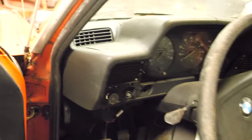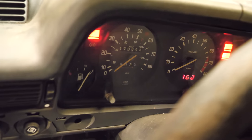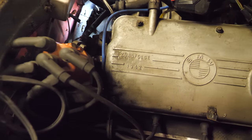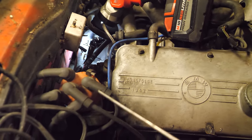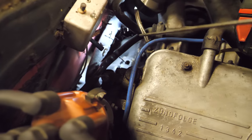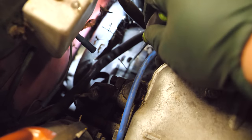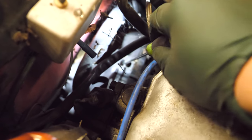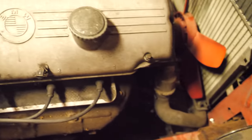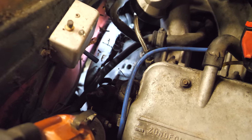Let's see if we have dash lights. We do — okay, this thing might start. Setting the ignition timing on this engine is pretty simple. You just need to get the engine warm, disconnect the vacuum advance which is here, plug that line, and then use the timing light through this oblong hole. It should be set at Z at 2200 RPM. There's actually a sticker here that tells you that — it's covered in mouse turds but it's fine. We're going to just get this thing started, get it warm, and do just that.